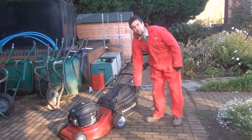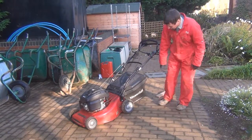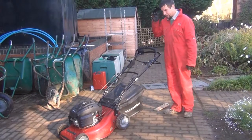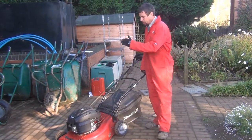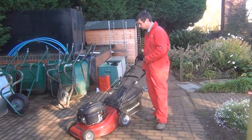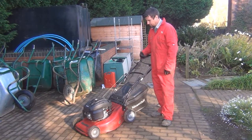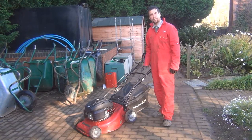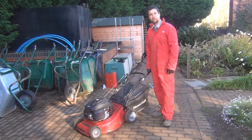You may have noticed we've also put the grass box back on — with that you would just check it's in good condition with no holes in the fabric, because you don't want debris coming back at you. So we've been through this machine, starting at the front and working our way back. We've checked the different parts of the engine, the fuel, the oil levels, the cables, and all the controls. We've started the machine and stopped it, and I'm happy that we've carried out the pre-start check. This machine is now suitable for going out and mowing grass.